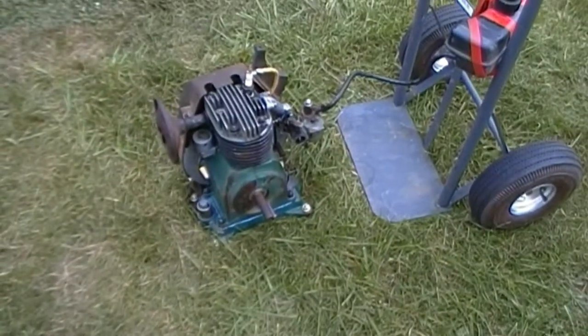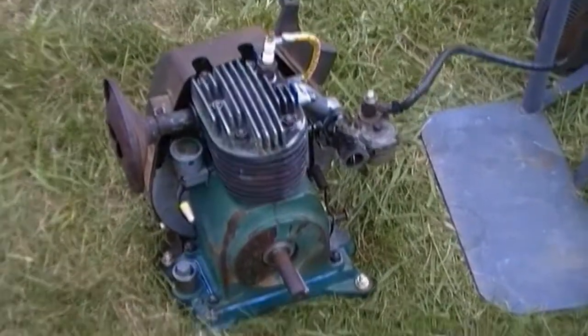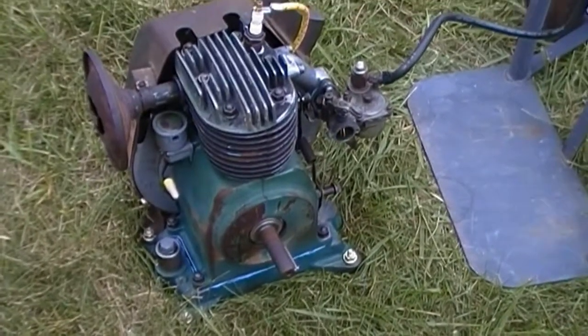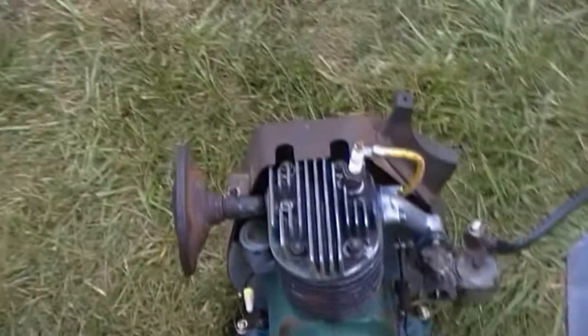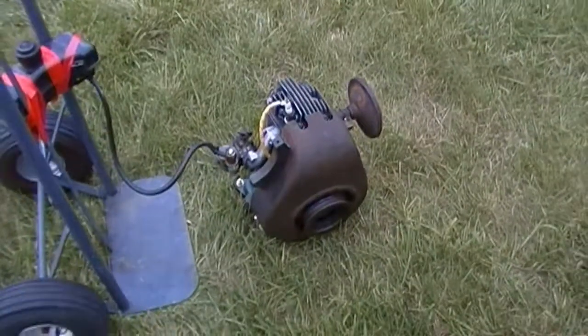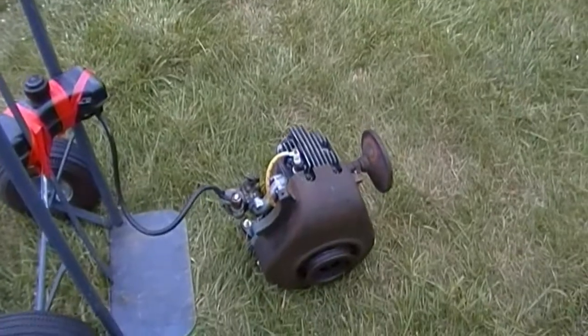Oh well. At least it was a successful swap out of the parts. Had to make a new head gasket. Original one leaked pretty bad. But other than that, just finish that throttle shaft up, clean the gas tank out, should be done.